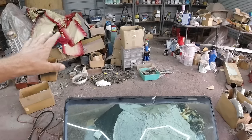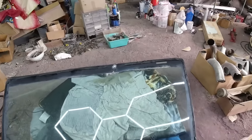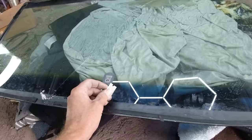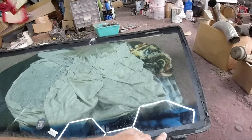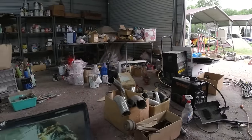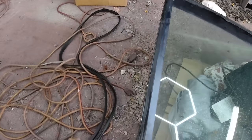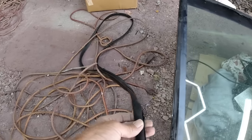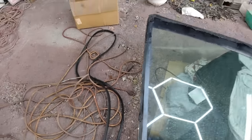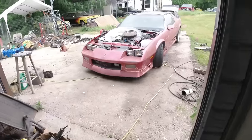I've got one coming — probably wait for next video. At least with the new windshield I don't have to clear all the old urethane. What you'd do is take a razor blade and go like this and take all that old urethane off. A new windshield won't have any of that. We just spread the urethane on the window frame after I get the old one out, spread it around, and plop the new windshield in. It's going to come with a new gasket strip too. No problem putting them in — it's easy. It's taking them out that's the hard part.